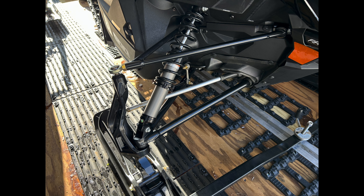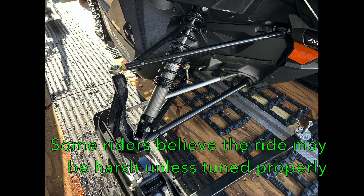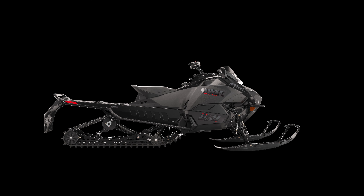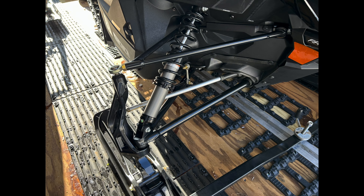Moving up in price and complexity are the Arctic Cat IFP shocks. IFP stands for internal floating piston. These are the base shocks in almost all of the full-size snowmobile models. Inside the shock body is hydraulic fluid and nitrogen separated by a piston. Theoretically, since there's a gas charge inside the shock, you should be able to change the pressure of that gas, thus tuning the ride quality. In reality, this isn't practical for most riders to do themselves. You need special tools, and any adjustments should be made by either a dealer or a qualified mechanic. These shocks are rebuildable — meaning the shock body itself, unless damaged, can have its seals rebuilt or replaced for a fraction of the price of a new shock, and there are repair shops that do exactly this for a very reasonable price.